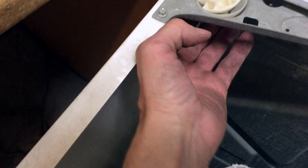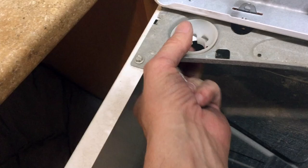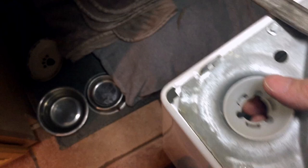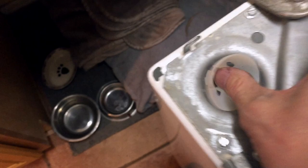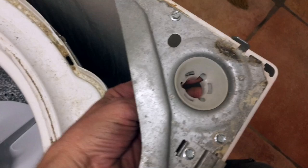Five of the worst minutes of my life, especially this last one — trying to get this thing out. Take the sleeve that goes around these out. These are the new suspension rods; you can get them on eBay, but I would order the ones directly from Whirlpool — they're around $57. I did a lot of searching and reading all the reviews of the $25 to $29 aftermarket ones. Read the reviews — everybody says the thing started doing the same thing after three washes. I learned my lesson: just get the real OEM ones, not the aftermarket.